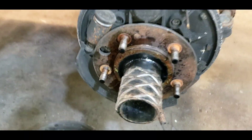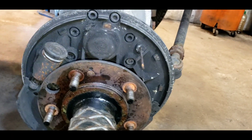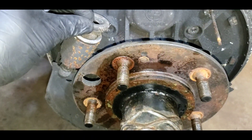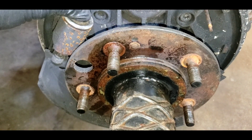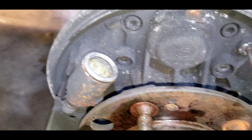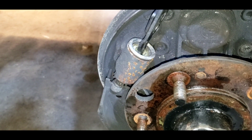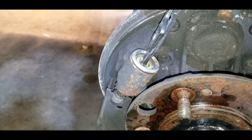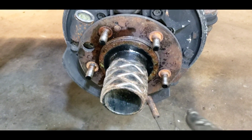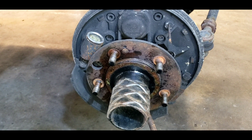We're a little further along on our repair. You can see we've got the brake shoe off on the top — this wheel cylinder is stuck. Got the hardware and shoes off. I know this wheel cylinder works; I saw it working. So we're going to pull off the dust boot, pull out this part of the piston — it's a two-piece piston — and the part that's stuck is that part right there. I'm going to try to get in there with a pair of expandable pliers and see if I can loosen it up. We're going to try to work this back and forth and exercise this piston. I'll probably do the same to the other one even though it's been working — I want to make sure we have equal braking. We don't want the truck pulling left or right due to stronger braking on one side.